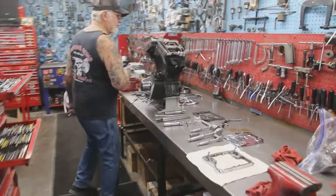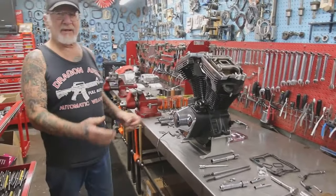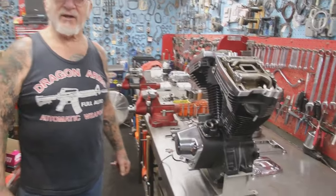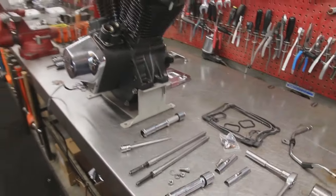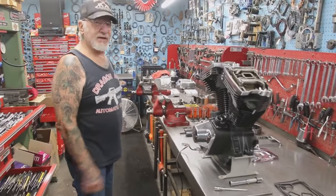This is another motor from Arizona. His friend flew him in right here at the Colorado Springs Airport, and he rented a car and spent a couple of days at Dragon Land. Meanwhile, I'm getting his motor done — today it'll be done. All I have to do is put the covers on the heads, the rocker boxes, adjust the push rods, and it's out of here. Less than one week.